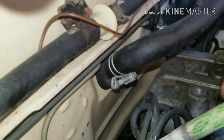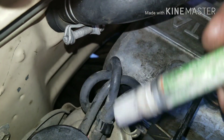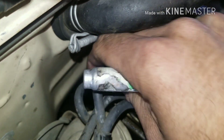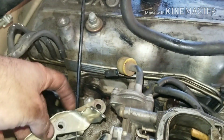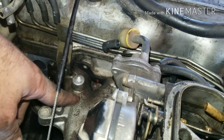Once you get your EGR loose, make sure you mark your hoses — especially this one here and there. Just label them one and two. Pull this one off from the back so you keep the EGR intact. Once the EGR is off, loosen this 12mm here and get that out of the way for better access.